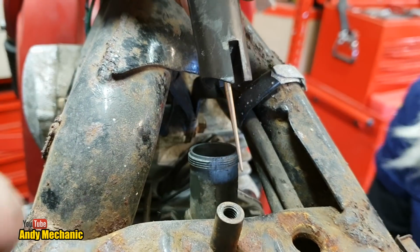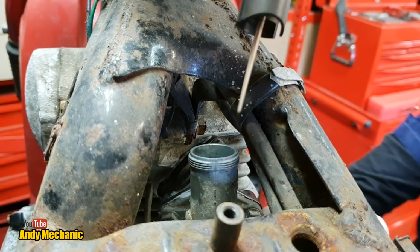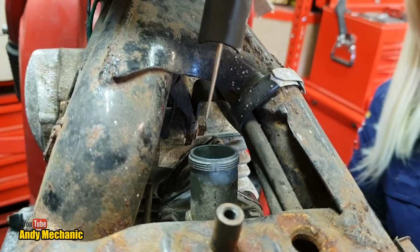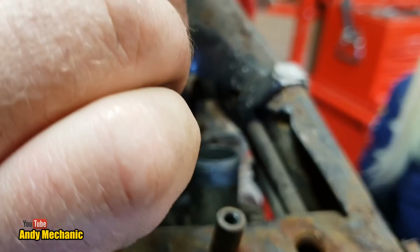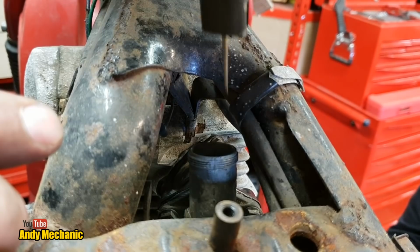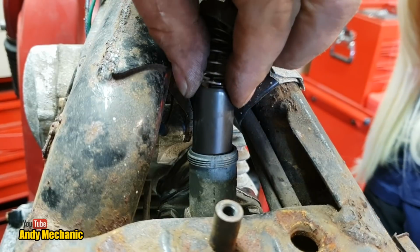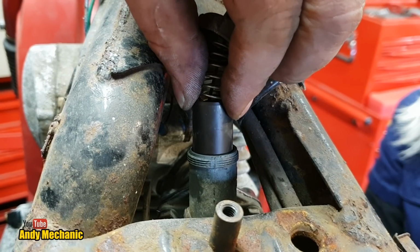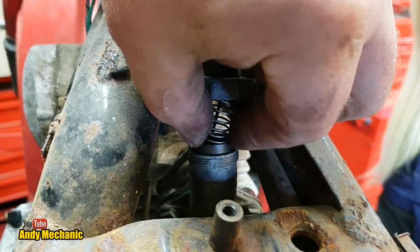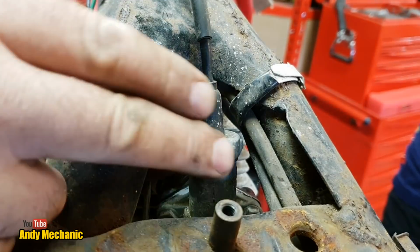So I think that's your side, isn't it? On the little screw down there, the adjustment screw. That's the one, yep. And then the other side will just have a groove all the way up. And there'll be a little brass dowel just sticking out inside the carb. So if you get this 180 degrees out, it won't drop all the way down, it'll sit. And then if you do get it started, it'll rev its nuts off. And it's also important that you don't force it down because you're also trying to get the needle into the emulsion tube as well. There we go. And it should drop. There we are. Right, we're in. It's always good.